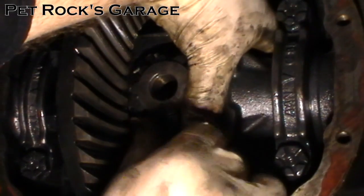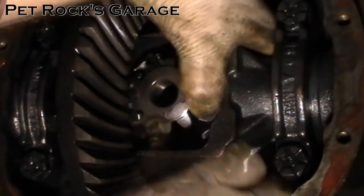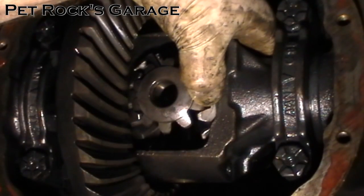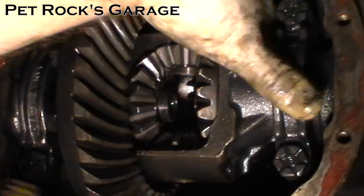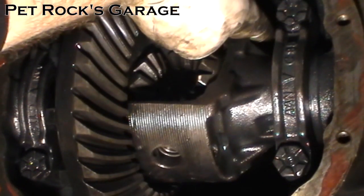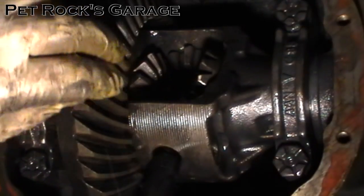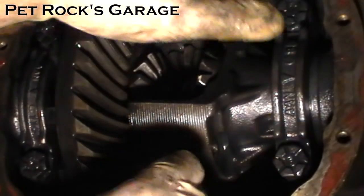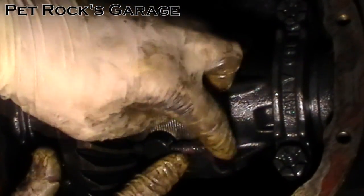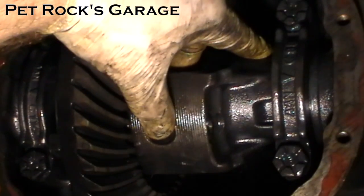In this case I need a little bit of an adjustment so I rotate one half slightly, put the gear back in, and now I can slide it all the way through. That means the spider gears are now lined up and I can rotate the entire assembly into place. Now you hold the spider gears from moving and rotate the entire assembly so you can get access to this hole right here. Take your center pin, lube it up nicely, and slide it into place. Once the center pin is in all the way, make sure that the hole that the locking bolt will go into is lined up, then slide it all the way in and rotate the assembly to a point where you can get the pin all the way through.